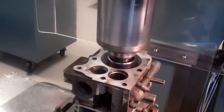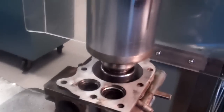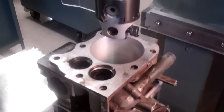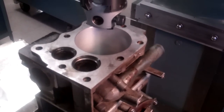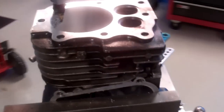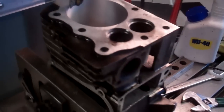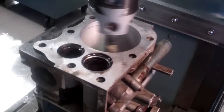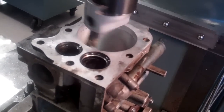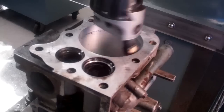We're at the end of the second-to-final pass and the machine has shut off. I'm going to take another couple of measurements, see where I am, and go to my final size — that will be the last cut. The cylinder is completely cleaned up now, it looks nice and I have no reason to believe this isn't going to be good. This is going to be my final pass. I'm very close to my 20-over size, and once this pass is done the rest will be taken care of with the hone to get my good crosshatch pattern.